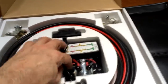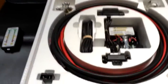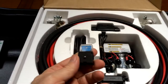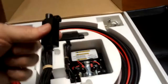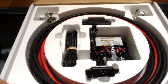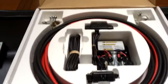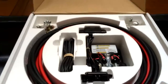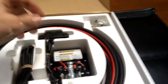This is the entire kit — you don't have to buy the entire kit; you can buy just the main device. But I thought it'd be nice to have the kit so I won't have to go chasing around for cables and stuff. These are fuses that are supposed to go in line with the system. However, since I'm putting a big fancy bumper on the front with a winch, they recommend leaving out the fuses because winches draw too much power and will blow them all the time.